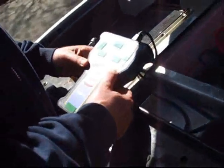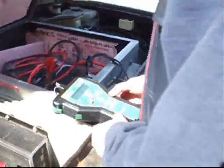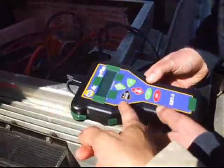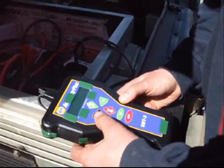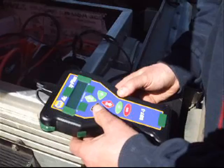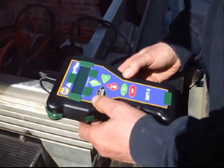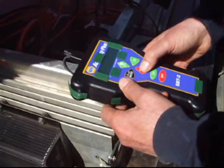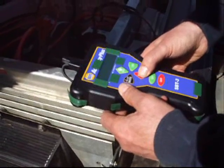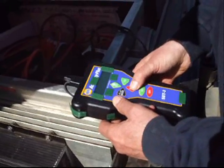You can test either CCA's — that's cranking amps — which is not what we're doing. We're doing amp hours. Hit the mode button. That's cranking amps for marine, we're not doing that. One more — now it's amp hours. The setting is at 69, but this is a 55 amp hour battery.